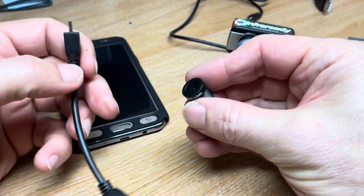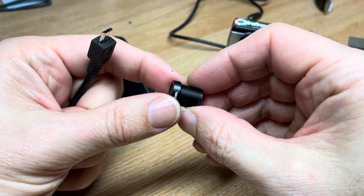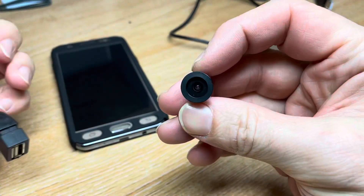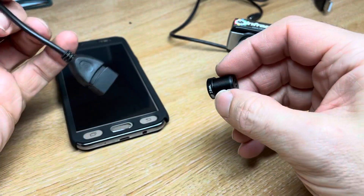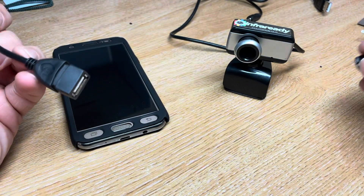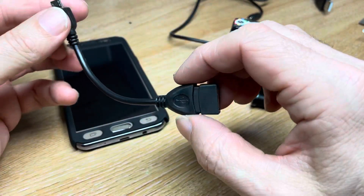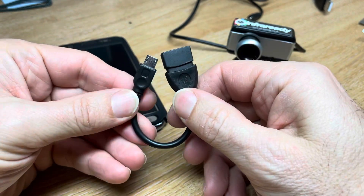The other part I'd recommend is getting a better quality lens. This one hasn't got an IR cut filter on it either, so you can actually make the camcorder a night vision camcorder — which, obviously being a ghost hunting channel, that's what it's all about.